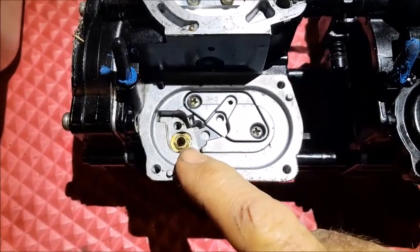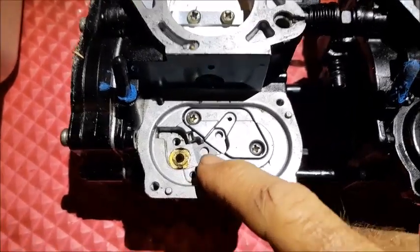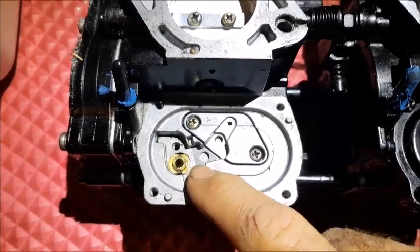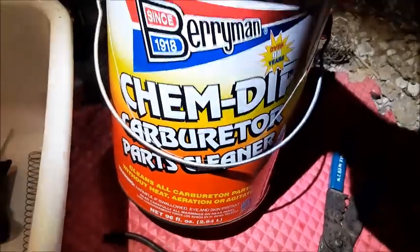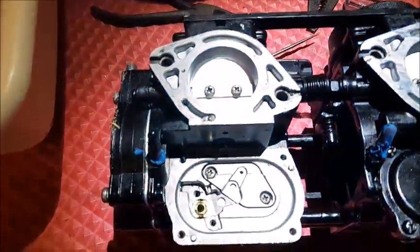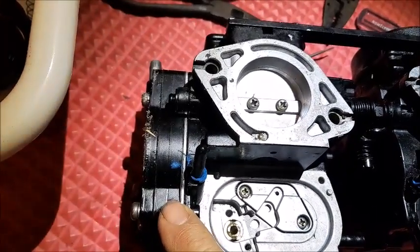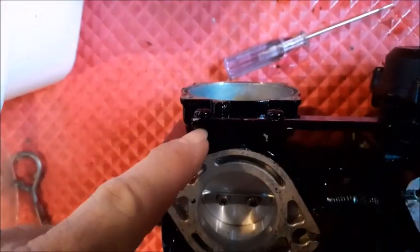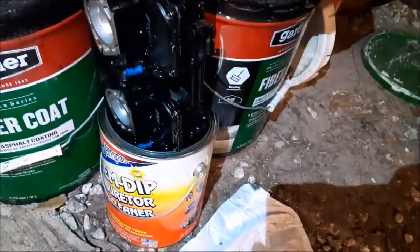It appears there's some old gas that got dried up and stuck down there on the O-ring. We've already damaged the edge of it so we can't even grab it with the pliers anymore. So what we're going to do is try and soak it overnight in Chem Dip carburetor parts cleaner — you can actually immerse the whole carburetor into it. We'll also soak this fuel pump at the same time since we weren't really able to take it apart. We had to put a little bend in the corner of the can to be able to get this corner of the carburetor to slide down through the opening to get down into the liquid. We've got that one carburetor soaking now.